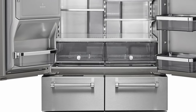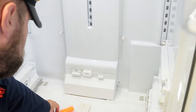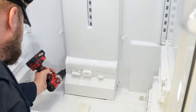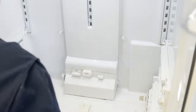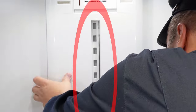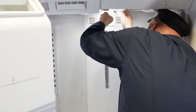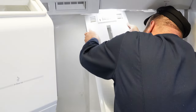Other models may require you to remove the large crisper drawers above the chef's pantry by pressing in on the retention tabs, then remove the glass, then the wire trunk hidden in the cross piece, allowing you to remove the crossbar assembly. Four and five door models may have a more extensive system to access the evaporator. I don't have videos on those teardowns but there are other videos on YouTube that will show you how. From here, use a quarter-inch screwdriver or drill gun to remove the screws from the evaporator cover. Once those screws are out, the air tower needs to be removed to allow the cover to come off, which is quite tricky.